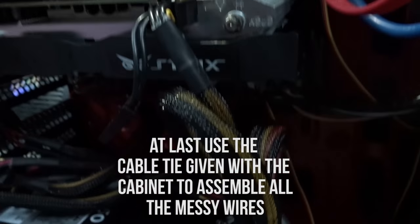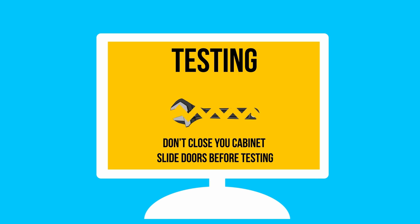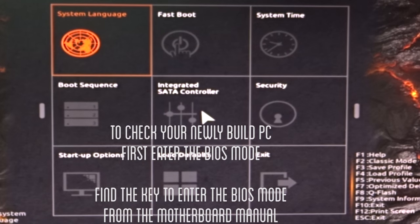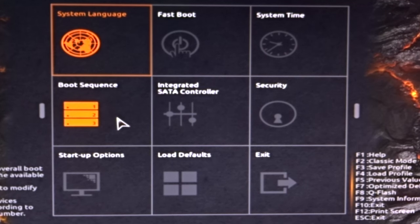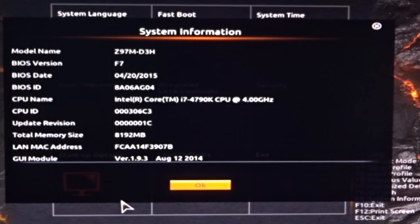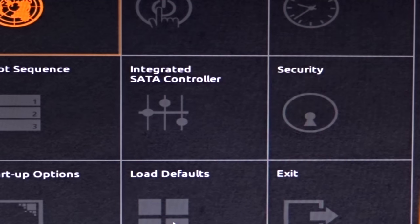Now it's the most important part — testing. To test whether you've done everything correctly, hook your CPU up with your mouse, keyboard and monitor. When using a graphics card, connect your monitor's DVI or HDMI port to the graphics card. After connecting everything, just boot up your CPU. To check if you've connected every part perfectly, go into the BIOS settings. Press the required key from your keyboard — that depends on the motherboard architecture, so go through your motherboard manual. As you can see, it's displaying Intel Core i7, 8GB of RAM — everything perfectly. There's nothing wrong with my connection. You have now built your own computer.